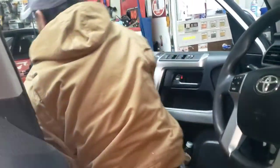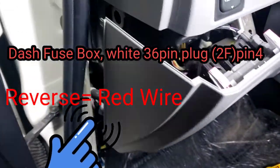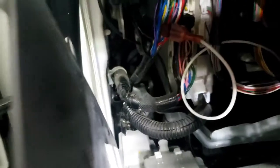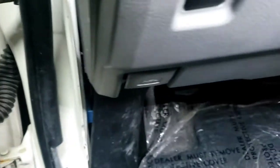All right, so we got that out. We're gonna go to the radio part. In order to hook up a backup camera, you're gonna have to hook up the red wire on the 36-pin white connector where the fuse box is — you're gonna have to pull this off. You can pull the whole thing by taking the 10 millimeter down here out and then just pull it out.